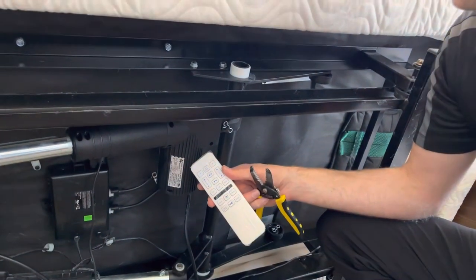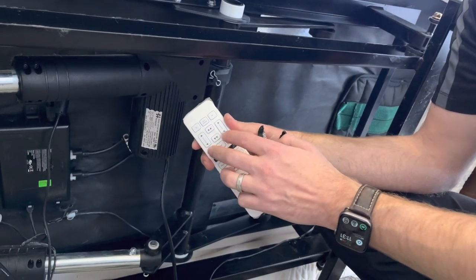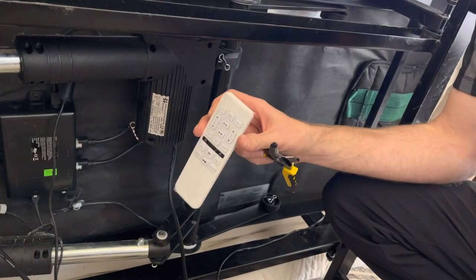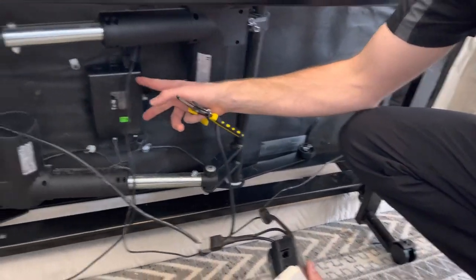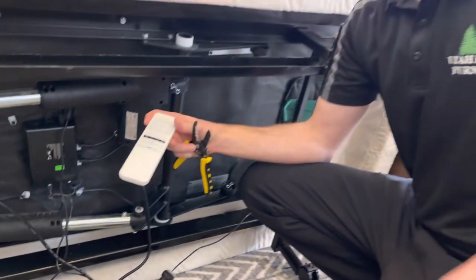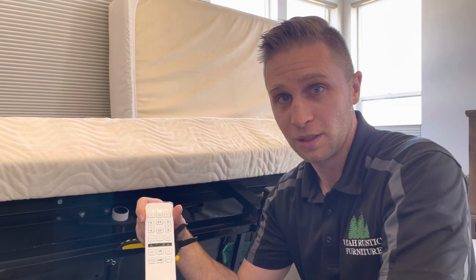On this exact model, both up and both down will work. Unfortunately, your presets and memory positions aren't going to do anything, and flat will work for a second and then stop — I think that's probably just normal behavior. And just like that, we've converted the bed base. The last thing I like to do to clean up and make sure no wires get caught by a vacuum or pets is to take the old box off and screw the new box inside of it to tidy up the cords. It's as easy as that. Let us know if you have any questions — these are available for purchase on BedRemotes.com. If you scroll down, the first four or five products will be either the white kit or the black kit, and we also sell a basic four-button kit without presets or massage if you want to save a little money. Thanks and have a great day!